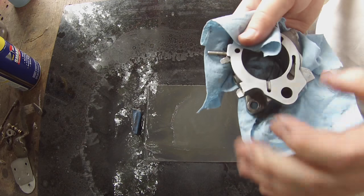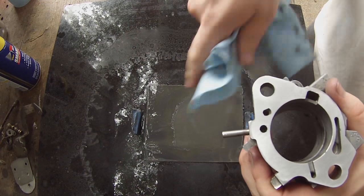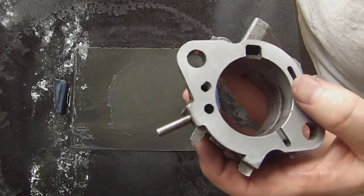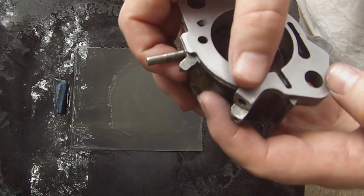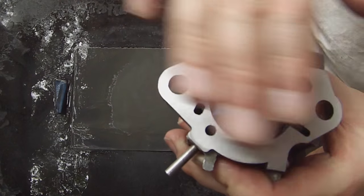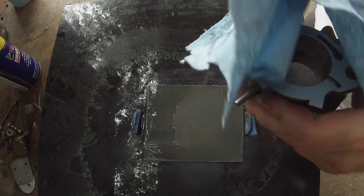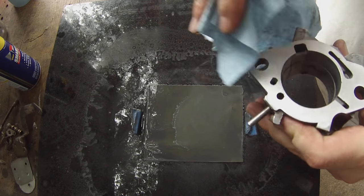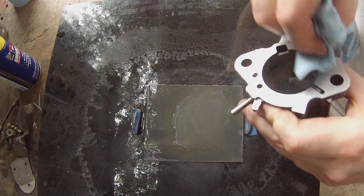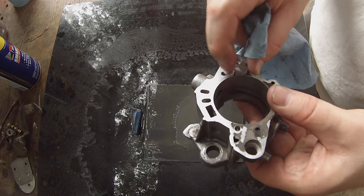So, after a few minutes of lapping this throttle body assembly, the lower portion of the carburetor, on the sandpaper on the granite tile, we've got a really flat, smooth surface. I got most of those deep, heavy scratches out of there. The one thing I was most concerned about was right in here, there was a low spot, and I kept having to sand it. Lap it in, lap it in, lap it in until I got down to that little low spot there. So this side, I'm not going to spend a whole lot of time working on this because basically I just want the engine to run and run reasonably well, because I do plan on doing an engine swap in the near future, hopefully. But this will help get it up and going, or back to running well.